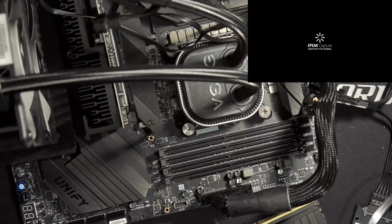Yeah, that's the thing, so you might be like, oh, I'm going to buy some cheap 16 gig 3200 CL16 sticks. They're going to be dual rank. I'm going to get the dual rank performance benefits. Problem is, as of somewhat recently, because if you did this last year or even the beginning of this year and you bought 16 gig DIMMs, you were pretty much guaranteed dual rank, because 16 gigabit memory chips were just starting production and they were very, very expensive.